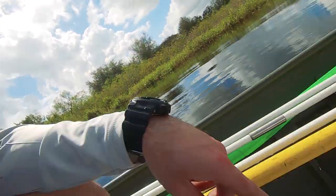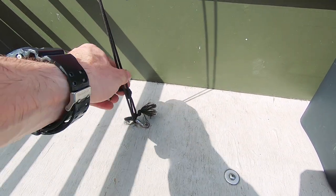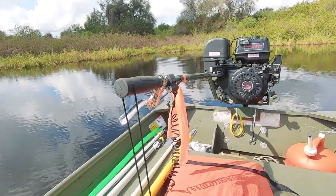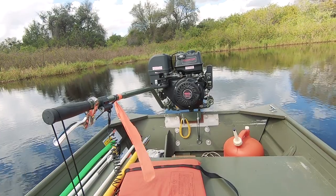That's a good little trick to know — why I have it set up that way. I have a floor so I just have this little half cleat here, and then I have this tied in a circle, just a big loop, so I can easily take it on and off. It keeps the motor straight. Now when I go into the ramp or if I'm in a heavy area with boats, I'll turn that tail around, put it inside the boat, and just use the trolling motor — that way it keeps my profile small so I can maneuver between boats in tight situations.